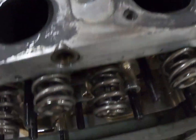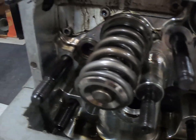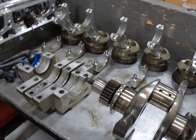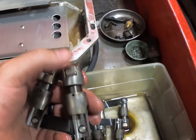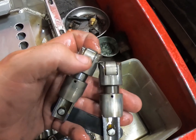As you can see, cylinder heads. I'll go through and look at all the valve springs and guides and all that other stuff and see where we're at with them. But like I said, the first time we let it sit down there, after the 577 pass, came back, let it sit for a few weeks, and the springs were just completely covered in rust. We had broken a couple springs right after the rust. I mean, they were rusted up hard and pitted. Made a pass, came back, and broke a couple valve springs.